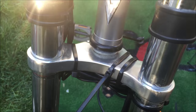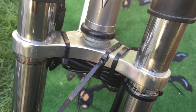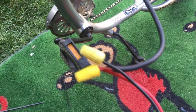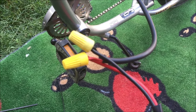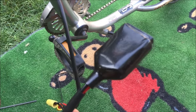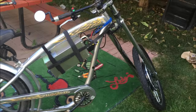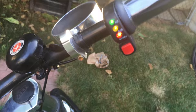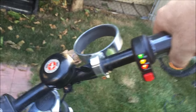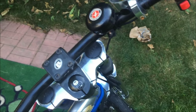I like to give this bike a test run today — I'll deal with those lights later. I've wound the two wires together with household wire connectors and put a standard battery cable on the end. I'm going to hook up the battery, hang it again, and go for a ride. Now I've got the battery hanging in there, it's plugged in, we have lights on the throttle, and if I turn the throttle the wheel goes — we're good to go.